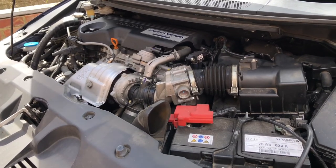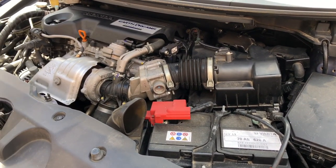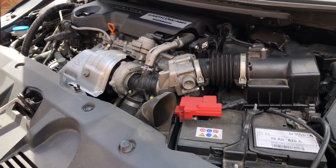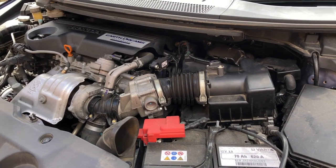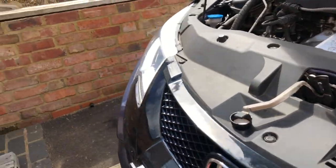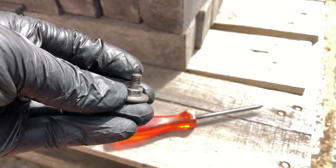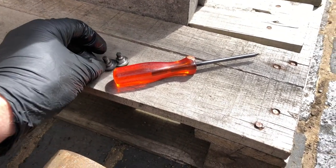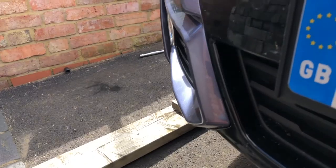This is now done - air filter done, oil topped up. It takes 4.7 liters, and true to Honda it took exactly 4.7 liters including the filter. The Bosch filter was a different fitting to the Honda filter - that was a bit of a pain but worked fine. Now I'm just going to stick some copper grease on these under-tray fittings. Some of them are quite stiff and reluctant to come out, so I'll copper grease those, button the front up, and then we can do the rear brakes.